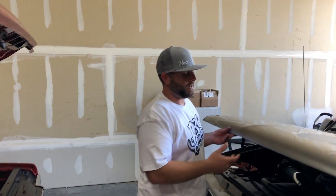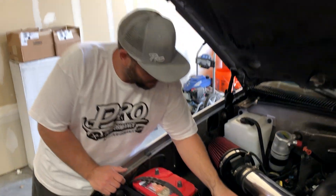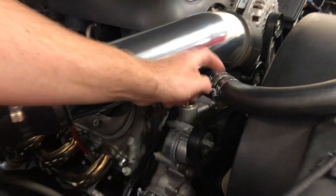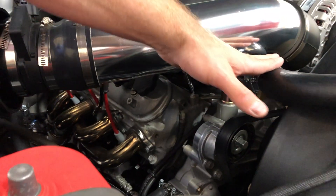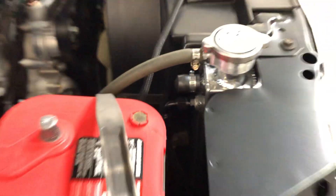This is also a non-LS swap radiator. The steam port is actually underneath — what we did is use a collar that slips into the radiator hose so you can run your steam hose right into that. It's not as clean looking, but it works. The reason we did it that way is because on this particular radiator the heater port is not threaded — it's just a large bung that's capped off, so there's no way to run a barb fitting into it.